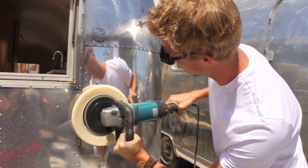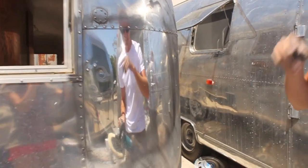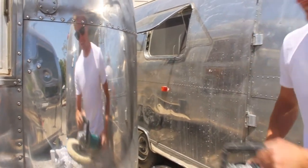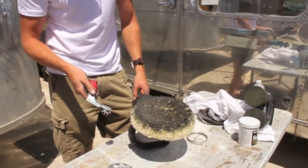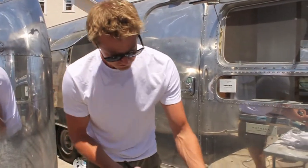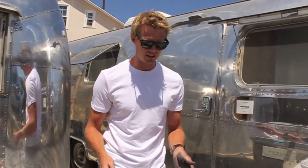About now you'll start to see that we're getting a much clearer shine. You can see the difference between the steps — you can see me through there now. You'll also use the spur when the pad gets full of polish, so you can extend the life of the pad. And generally that's stage C. The next step would be on to S, the final stage, and we'll see that in the next episode.